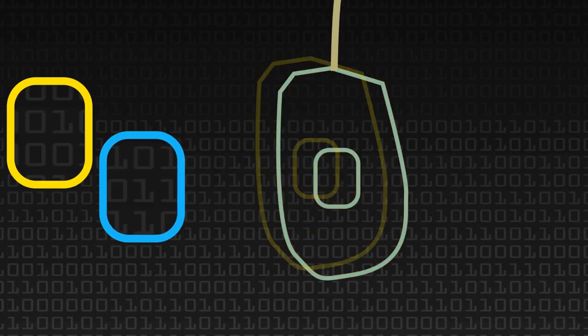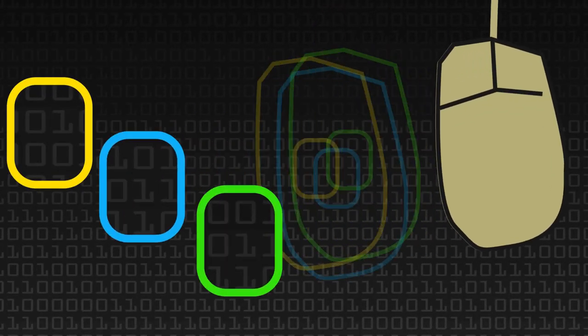There's literally a little camera photographing the desk several thousand times a second, or however fast the camera's refreshing. And then as you move the mouse, the image will change. And then it's doing a comparison of the two images to work out how they've been shifted. The same sort of comparison you would do in a video compression algorithm to work out how to move one bit to another. And once you know how far you have to move the image from the previous frame to the next frame, you know how the mouse has moved,